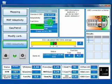For the last choice, we have Fiat fuel trims, that are for some Fiat cars that have a strange kind of fuel trims that are not leading to 0. The optimal value is not 0, but it's 99 or 100.